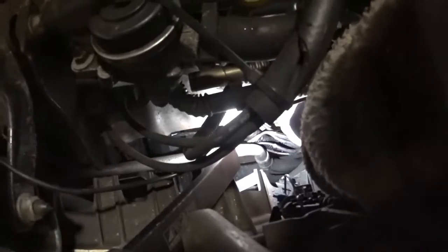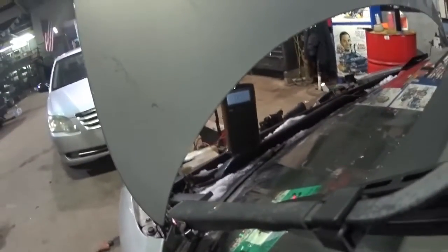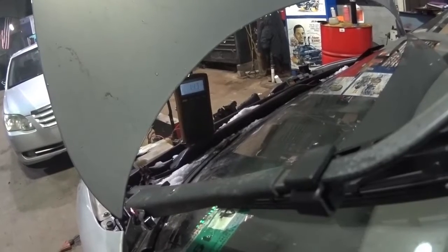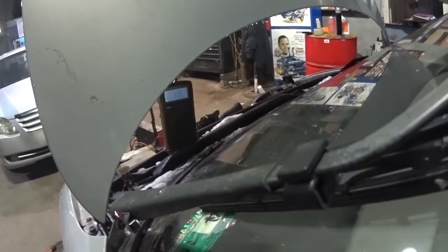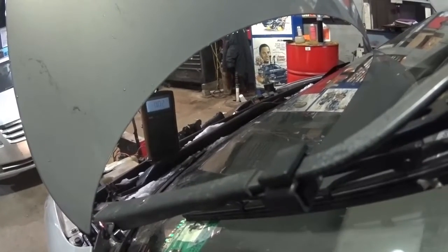Basically what I'm doing is going on the case of the starter. This may prove difficult but I'm going to try my best — hopefully I have a connection there. I'm keeping you focused on the meter. Turn the key on, crank it — look at that. That is my negative side battery cable versus the case ground on the starter housing.